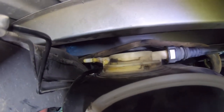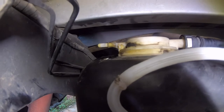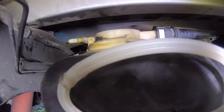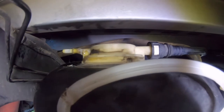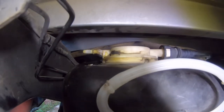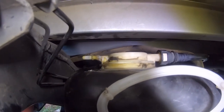Welcome back. We've got our fitting epoxied. We're just going to give that some time to dry — it says it sets up in 15 minutes and sets in 30, but we'll give it overnight, plenty of time to set up before we attempt to plug our vent pipe back into the end of that fitting. We got plenty of epoxy on it — it kind of mushed out the edges when we put it in, which is what we're looking for. We made sure that barbed fitting was clear prior to inserting it so we definitely don't have any glue blocking the vent opening.